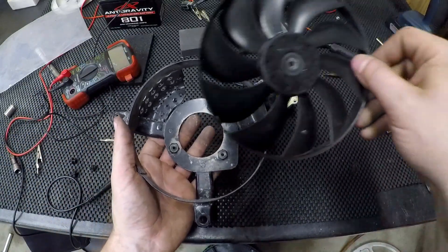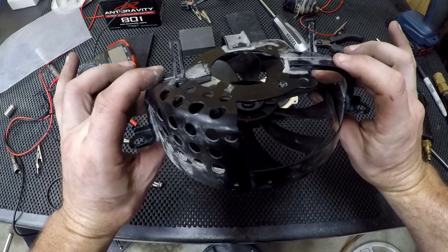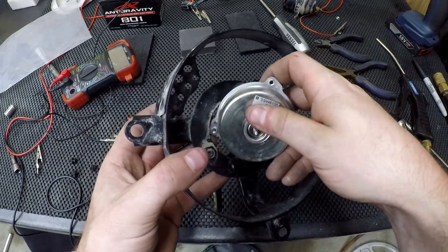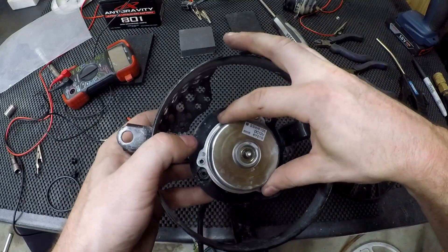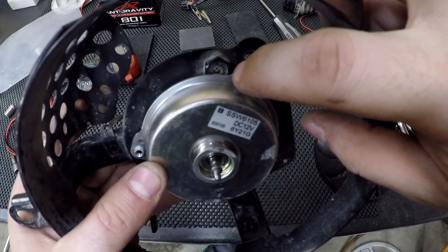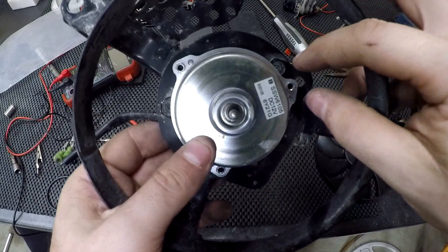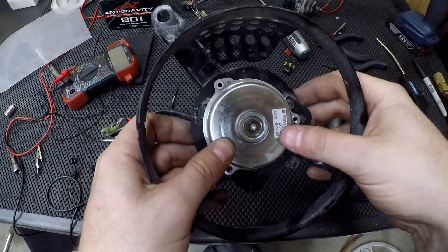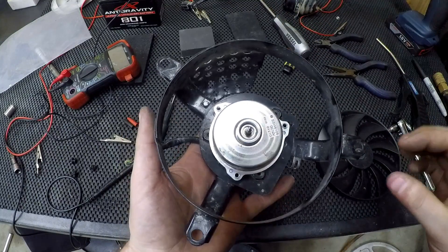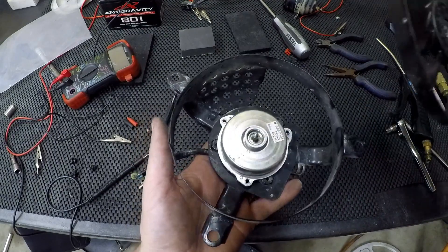Here's the Ducati fan in the KLR housing — they fit within each other very, very well. I've found that if I put the Ducati motor in, I can clock it. There's just a slight interference with the edge of the motor at each mounting screw on the KLR housing — like that on all three. If I just clearance just the edge on those three spots, it's going to be centered and then I can go ahead and screw in from the other side, clamping it and keeping it isolated, without making any serious modifications we couldn't come back from.